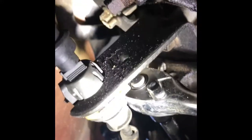That one's kind of tough to get to. If your extension is too long you're gonna be in the way of that transmission linkage, and I didn't want to bend that. So I finally found the right combination to get the length I wanted. You pretty much have to wrench the bolt all the way out because you can't get your hand up under there to manipulate the bolt.